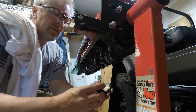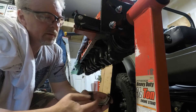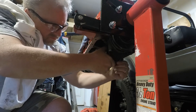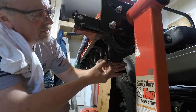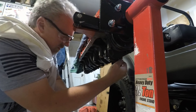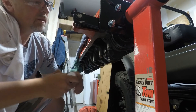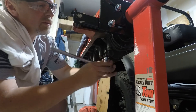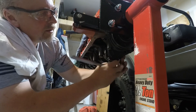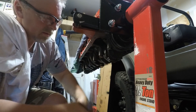We've got our rod cap here. The notch in this bearing half will match up to the notch in the other bearing half. The smooth edge will match up to the homemade oil squirter notch that we put in. Get that in there like so. This is a half-inch hex, only 5/16 thread — we're just going to snug them up. All we're going to do with all these is snug them up until we can flip the block over, and then we'll torque them to spec.